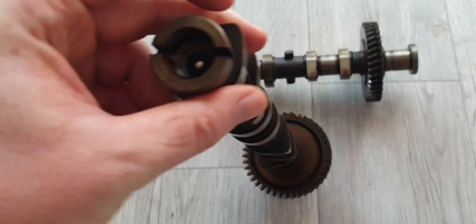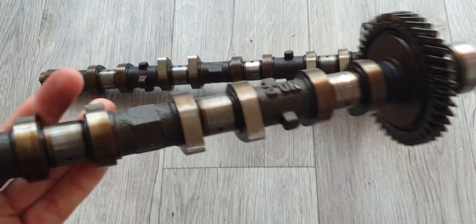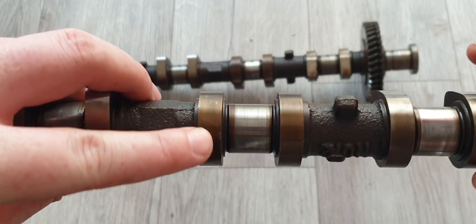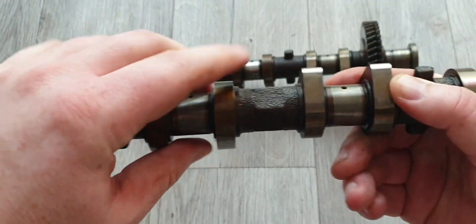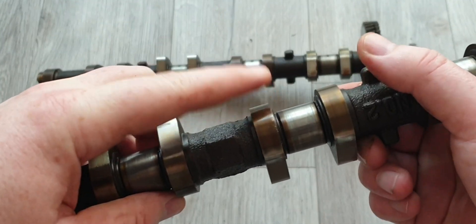If you want a lot more budget, you would keep these stock. There's also the option of camshaft regrinding, where effectively the base of the cam gets reground closer to the shaft — they won't actually add material, but rather take from the back, because that's the ultimate base where you start from.